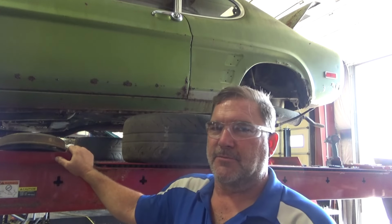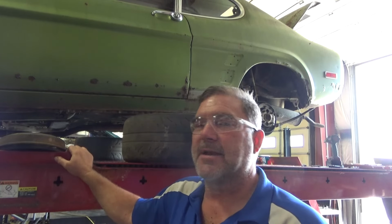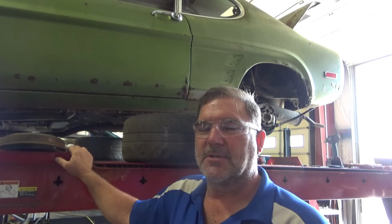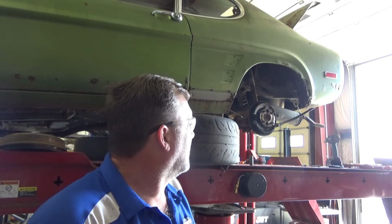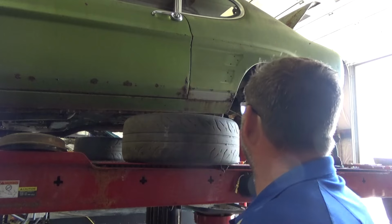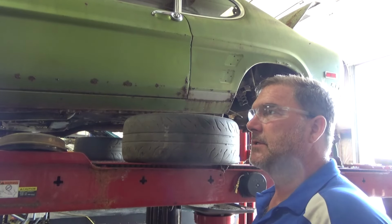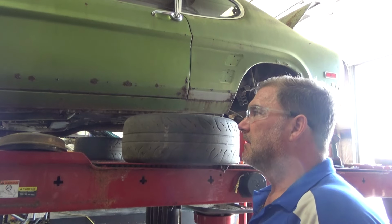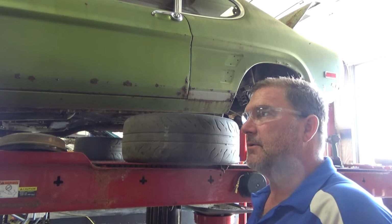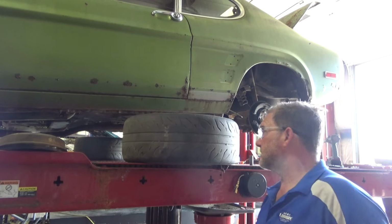And then I found another excerpt where there's also an axle, which is this axle, with the retainer clip style, and it specifically says to use a slide hammer to pull it out, which means I'm probably going to destroy something taking it apart, and that's fine. I'll just get bearings and seals ordered for it. But I'd like to get the studs in, because why not? I'm here. Might as well get it done. Let's drop this back down. We'll let the rear diff drip dry, and then we'll put the cover back on. We dropped about 3 pounds of weight off the back diff by cleaning the goo off of it, so that's a plus.